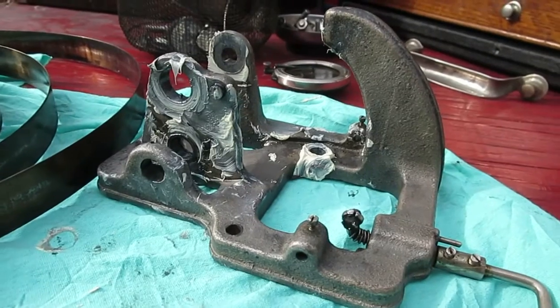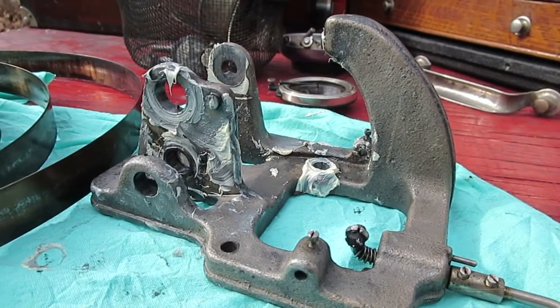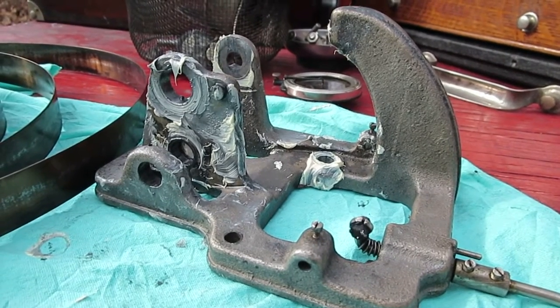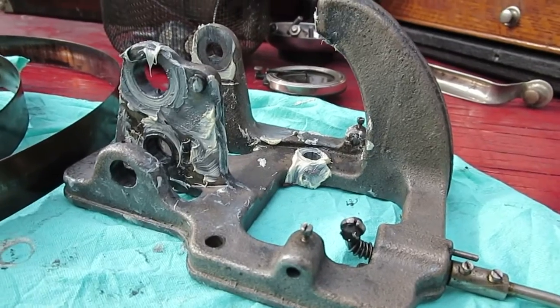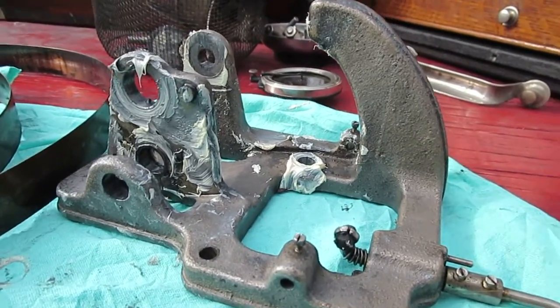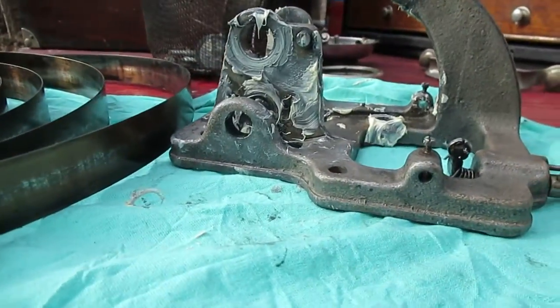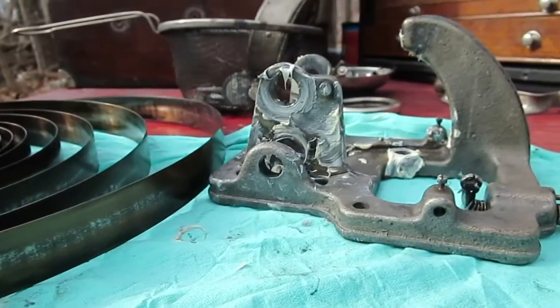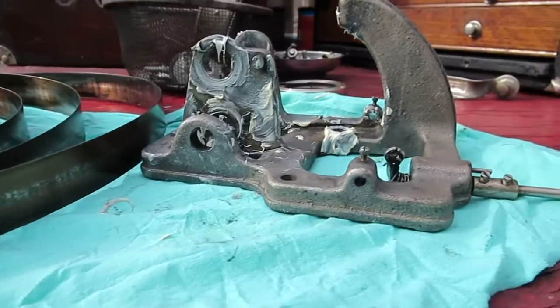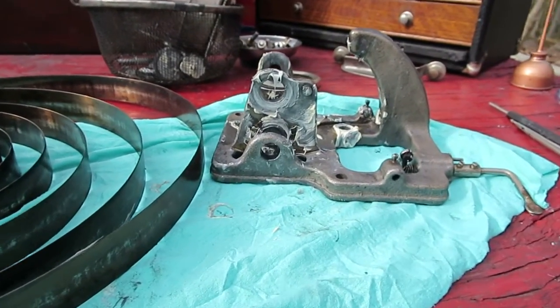This is the motor frame, and you can see somebody had made an attempt to lubricate it using white grease on absolutely everything. White grease has its place and does work very well on the gears and such, but it really doesn't belong slathered all over the entire motor. That's not how you're supposed to clean and lubricate a Victrola motor. You take it apart as you see here, clean it properly — I use gasoline, but you must be very careful doing that — and then reassemble it with new grease.